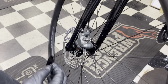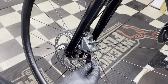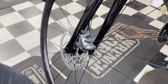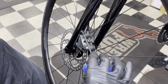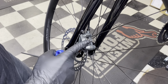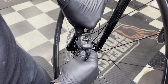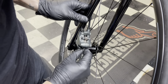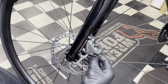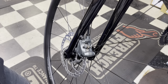The way this tool works: loosen the bolts that lock the caliper to the fork, center the tool onto the rotor, and shimmy it in between the pads. Once it's seated in there, you're set. In some instances you might have to drop the wheel out and push a wedge between the pads to get more space, but let's see if we can do it without that first.